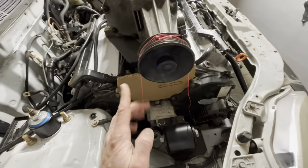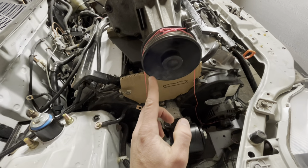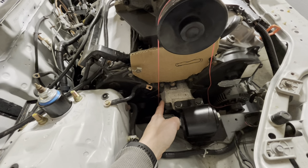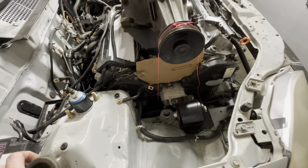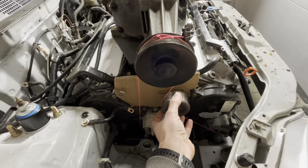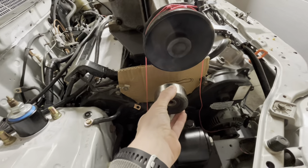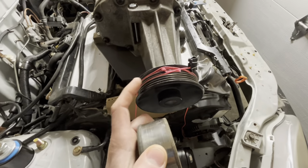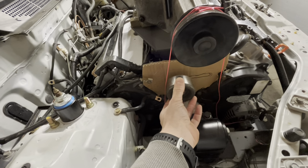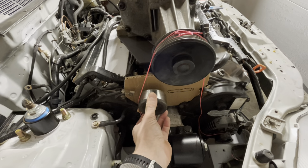So when I do that, it's gonna move the belt closer because the radius of this is gonna be smaller, right? And then it might interfere with this motor mount here. So what I may do is design it so that the first iteration just has this single tensioner like this. And then the second iteration has a ribbed tensioner. So instead of a smooth one like this, it's a ribbed one that just goes maybe like right there to hold it out a little bit.